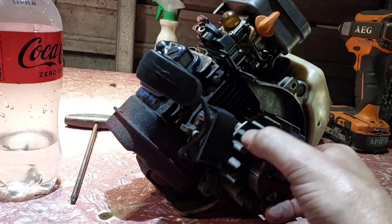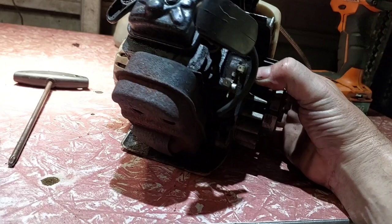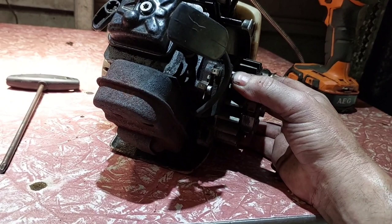I think it's going to be the crank seals, because it's done a lot of work. These seals wear because on a pole saw there's a lot of tension — a lot of lateral force lengthways on the crank, side to side. So she might be worn out that way. I can't find the flywheel — wait, where should the flywheel be? I think it's at the bottom of the crank.